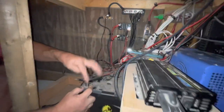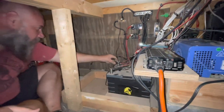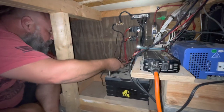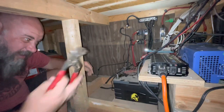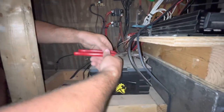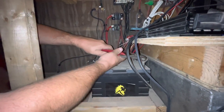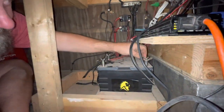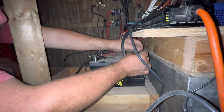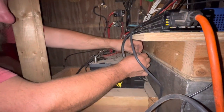The new batteries I'm adding in here are a little bit bigger than these ones, so I built a whole new battery tray to replace the old one. One issue — I have rubber coated handles. If you grab onto this post and go to loosen that and you make contact over here, you're grounding it between the positive and the negative. Sparks will fly — it's like welding happens, metal will melt. This is a low voltage system so it's not extremely dangerous, but you can still mess up and get into trouble, so you do have to be very careful.